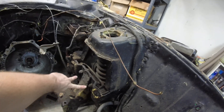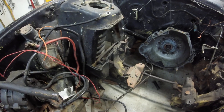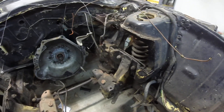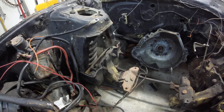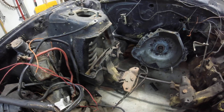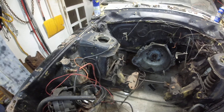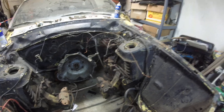One of the big problems with these is the upper A-arms are just bolted to the sheet metal in the back of the towers, and they tend to move out of place after years of getting beat down. So one of the things I need to do is put these back into place and put something in to brace those. It's more out of the way than the original shock tower so I can fit a larger engine and headers in here.